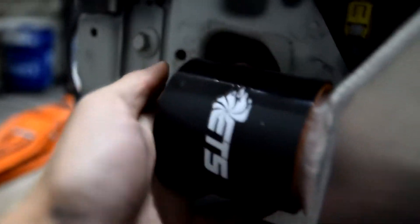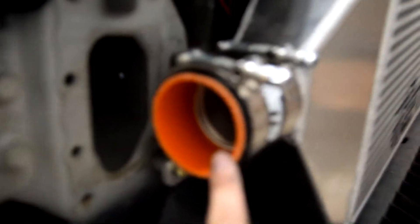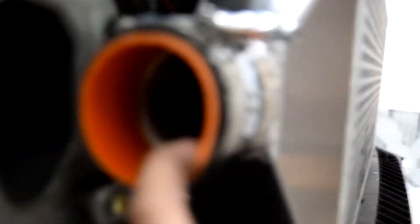I'm going to move back to working on the intercooler. What I want to do next is install the fitting pieces so I can get all the pipes connected. There is one fitting where one side is slightly larger than the other — this is the only one like it — and we're going to place it on the driver's side of the intercooler. I got all the fittings and clamps where I needed them, including down on the lower fitting. I'm going to work with the passenger side since I already have that pipe pre-assembled.